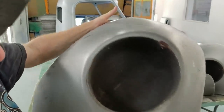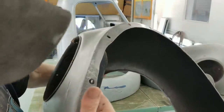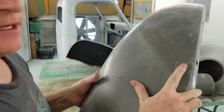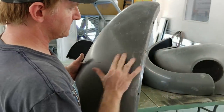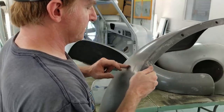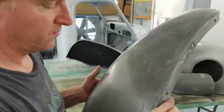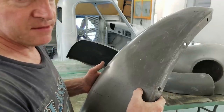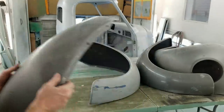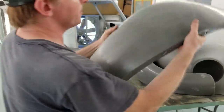Bucket looks okay. The rest of that looks good there. The lip looks pretty good. So we have one issue right there that's going to have to be addressed because that took a very bad hit. And what it did was it spidered out the gel coat. Anything you do on top of this to bury it will always come back. We're going to have to dig this down and repair this. We'll go over to the passenger rear.